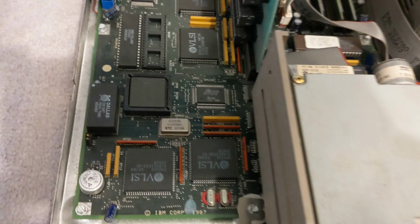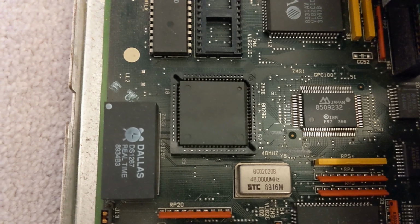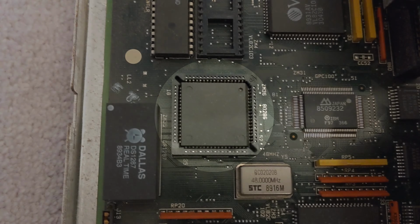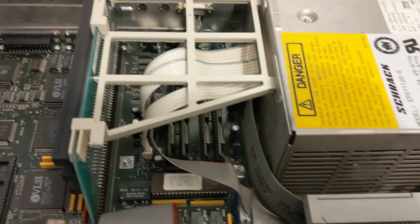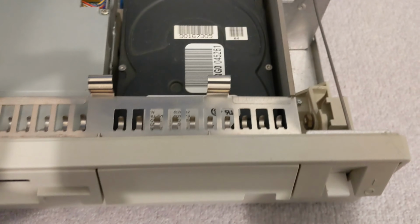When we look back at the early days of computers, this one from 1987, an IBM 286, now that didn't need any extra way of getting the heat out of the CPU. It's small enough, there's not many transistors in it, it doesn't generate too much heat. But later on with the IBM 386, it did need a little heatsink, and then it sort of built up. The passive heat sinks getting bigger and then requiring fans to dissipate the heat even faster.